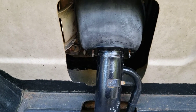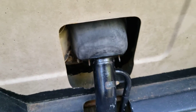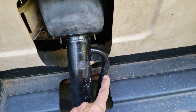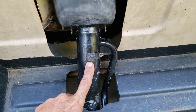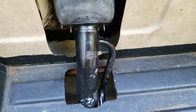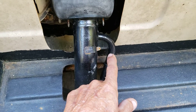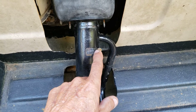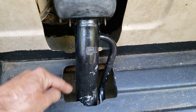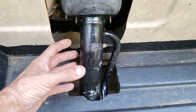It's a little bit bigger than what it needs to be — it could be smaller, but I just went with it. The biggest thing is this plastic piece: you can see it sticks past, so either way you're going to have to have a decent opening. You're also going to have to weld a tab onto your filler neck for a ground, so you don't have static electricity when you're filling it up. I just took a piece of metal, cut it, shaped it to fit a female connector, and plugged it on there. Same thing on the floor — I started out small and got bigger and bigger until I could get the angle to fit without hitting the bed.